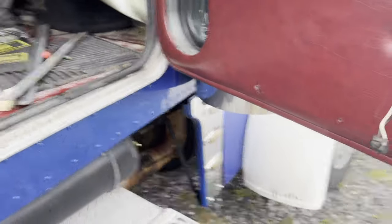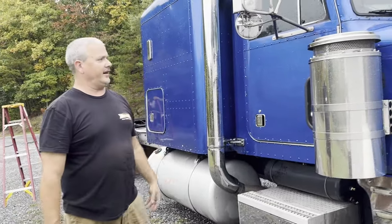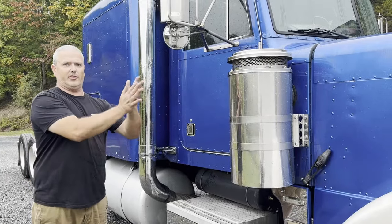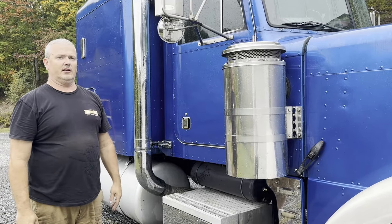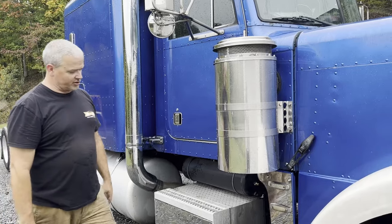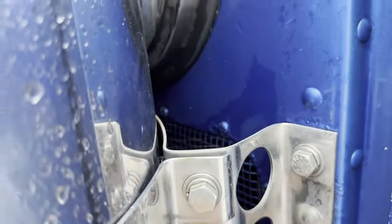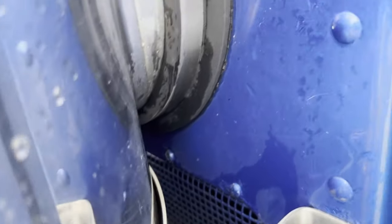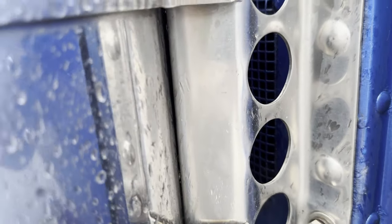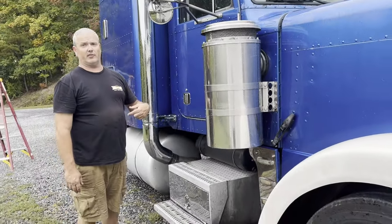Because it is pouring in. Y'all saw just how a little bit of water Angie sprayed and — the ductwork's on the inside and I'm betting there's supposed to be a gasket around it to seal it. So taking that air filter off will allow me to see it, but that's it — unless these Phillips head screws are holding that ductwork to the truck. If so, we pull the air filter off, take those screws out, and the ductwork can come out.